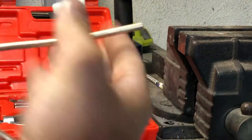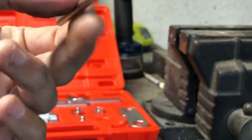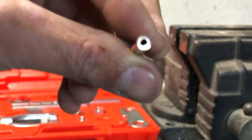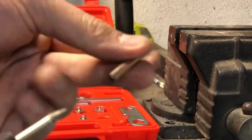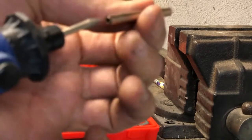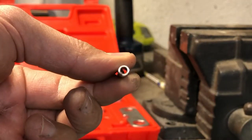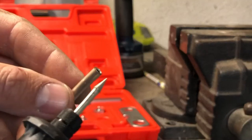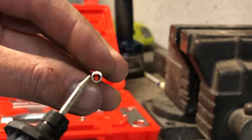I'm just going to cut this pipe here. I've cut the pipe and I've just got a little stub here. I'm going to show you what prep work I have to do, because as you can see this is really burred up where it was cut. I use a diamond-studded cone bit and I dremel out the inside — see how that opened it up. Now the other thing you want to do is put a chamfer on this all around the outside edges, so it has a nice 40-to-45-degree, almost rounded-off edge, and I do the same thing on the inside.